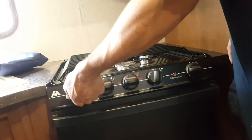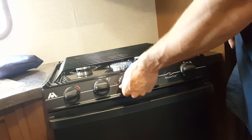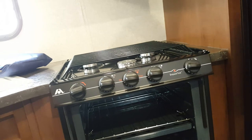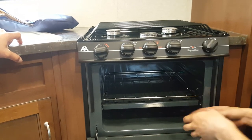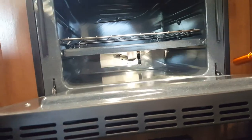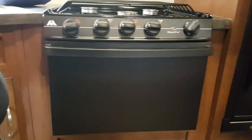This is your oven and stove. For the stove top, turn your dial to light — this is your igniter dial. Turning it lets the LP come out and sparks it; then you set your flame temperature. The oven you will have to manually light. Turn it to pilot and hold it down to let the gas in, then stick a long stick lighter into the back bottom to light it. This is the only thing on the coach you'll need a lighter for. That igniter dial sparks all three burners on the stove top.